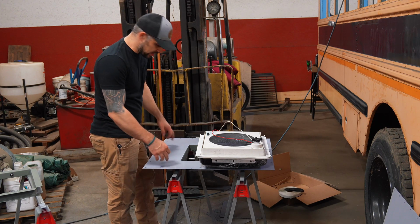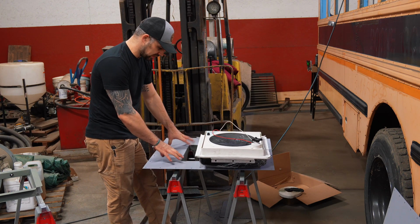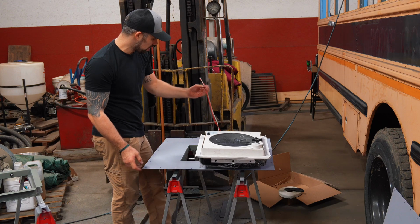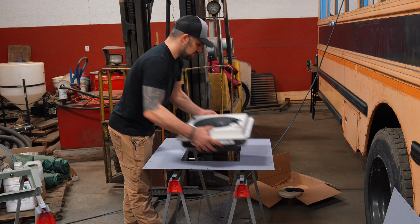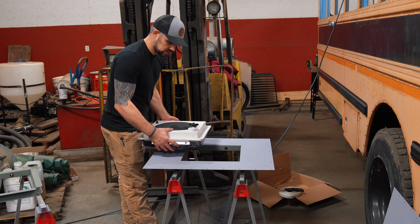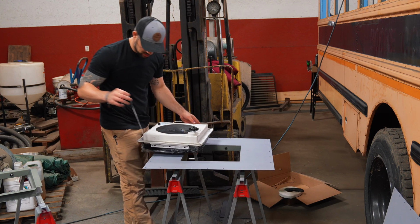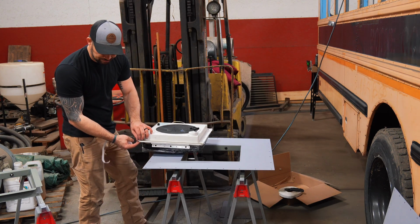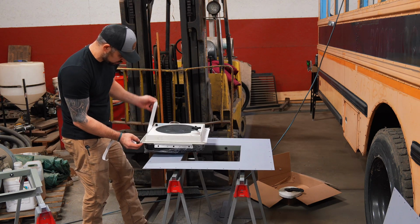The next day. So I got the butyl down on the vent fan. I've got everything kind of lined up. So I guess I'll just feed the wires through the grommet on the frame and kind of just get it all into place. I've got some self-tappers with the rubber washers on them. We're gonna use some caulking for them.